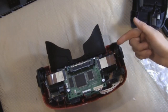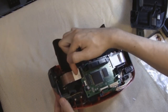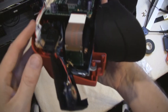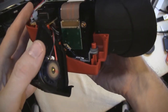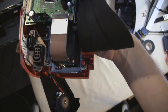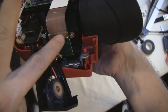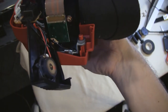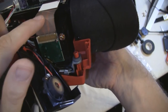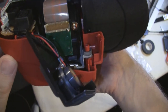The thing that will most likely need to be repaired is this ribbon right here, and the component it attaches to at the bottom. Here's a closer look at what I'm talking about. There's a couple of screws here that I need to take out, and I need to slide this ribbon out from that white connector. There's some glue right here that needs to be melted and reapplied, because this circuit board and this ribbon are connected by that glue, and over time it comes loose.